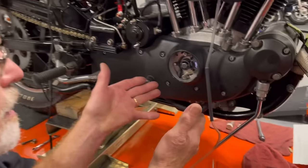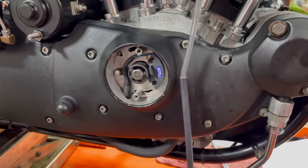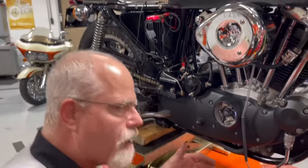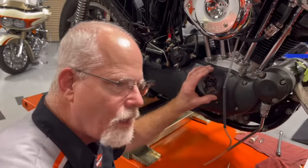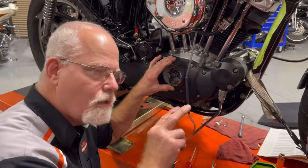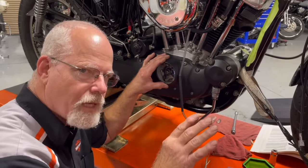Yes, you're zooming in and you can see it's a Dyna. It's not period correct — this guy has done a great job with this XLCR — but this is a superior ignition system for this bike. I've put points in shovels and early Harley-Davidson electronic systems, but the Dyna system is simple and works fantastic. It's two wires: a blue and a white. White goes to the power side of the coil, blue goes to the other side. You're done.